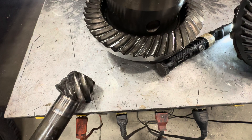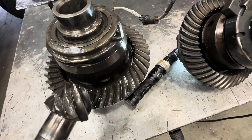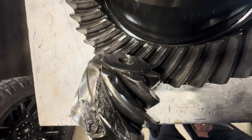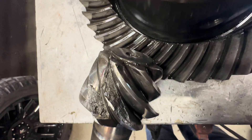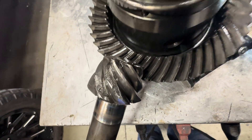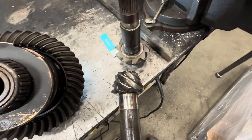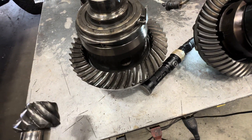Also, with this gear being a 5.38, you only get the engagement of really like one tooth in there. One solid tooth in the gear — and it doesn't matter if you have a Dana 44 or Dana 60. Pinions still have the same amount of teeth. The math is still there because with 5.38s, it still has to have the gear count to make a 5.38.